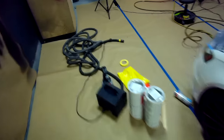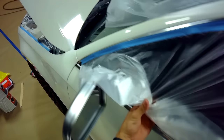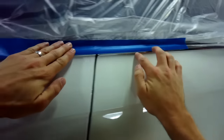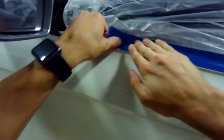Now I've got my blue tape and my yellow tape. I'm going to start unfolding the tape and drape to about the area where the bottom window trim is so we leave all the excess up here. We're going to seal off the tape and drape with the blue tape first. You can leave a little area down here because we'll go in with the yellow tape for edge work. The yellow tape has a crisper line, stronger adhesive, and it's better for all-around edges. It's also a little more chemical resistant than the blue masking tape.